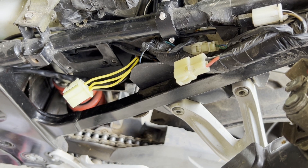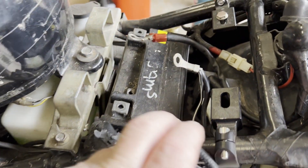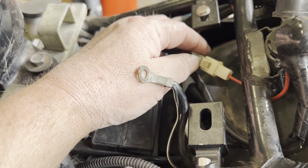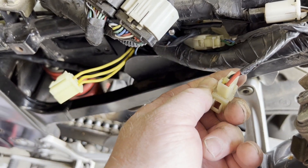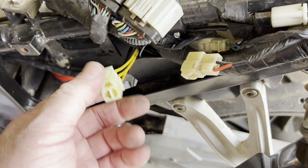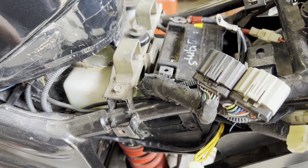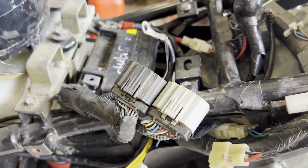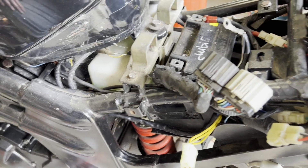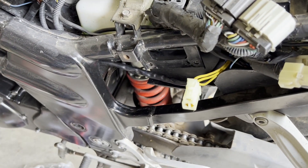I'll be isolating the original connector — that's still powered when your battery is plugged in; it handles ignition and pretty much everything. The wires are terribly small for what they do. Pretty much all of these bikes have dramas with melting plugs at some stage. Your stator can take out your regulator rectifier, then you fry batteries, and you get gremlins — they run funny, especially on an injected bike.